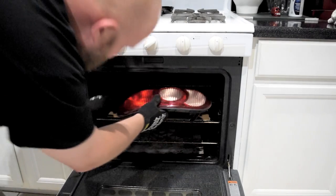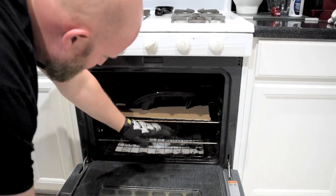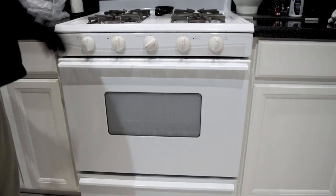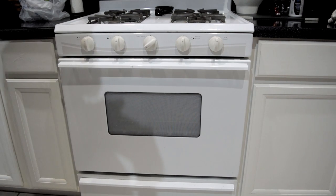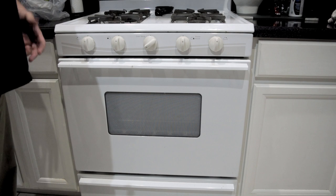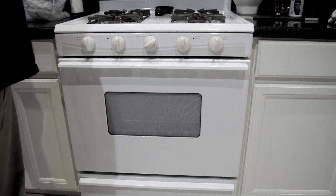I'm going to put it in lens side up, and I've already made sure the rack has enough room. I'm going to set a timer for about 15 minutes — somewhere between 200 and 250 degrees for anywhere from 10 to 20 minutes. It kind of depends. I've done Chevy Silverado headlights, and they seem to need a bit more heat than a lot of the more Japanese brands.